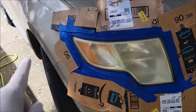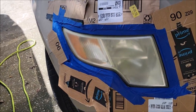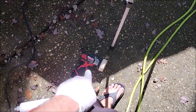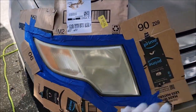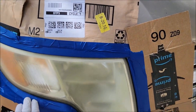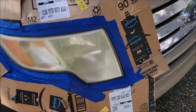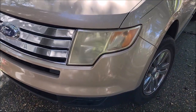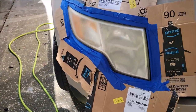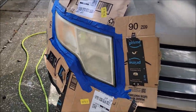So I'm going to show you now how to apply this stuff on headlights that were restored. So here we go. I have masked that up because I am going to be spraying this stuff. I'm going to actually put a little section there too, but you can see the headlights aren't bad — they're definitely yellow. I'm going to polish them with the Milwaukee three-inch rotary and some Smart Finish. Then I'm going to wipe them down with alcohol. Normally you'd use Universal Clean and Prep — one part product to seven parts water — to remove any polish residue before this coating. Both of them are yellow and hazy. We'll bring them back first, and then after that we're going to spray on some of the new clear coating.